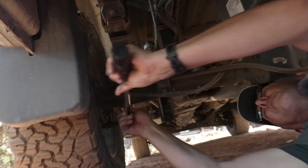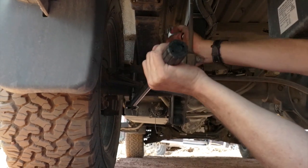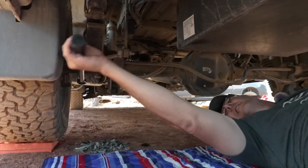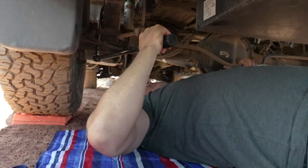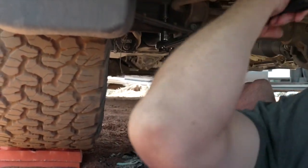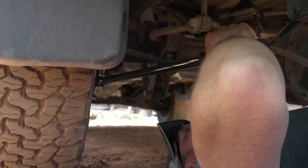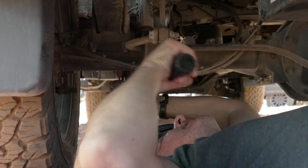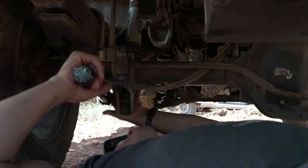You want to do front and rear. We are getting a little movement out of this one, not much though. I don't have very good leverage here. We got a little bit of movement out of that, but not much — just a slight bit of movement. That one's good. So those are good, there's no adjustment needed. We are at 75 foot-pounds.